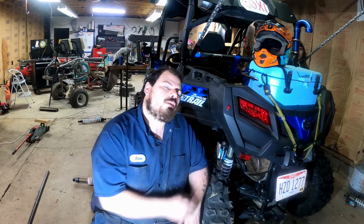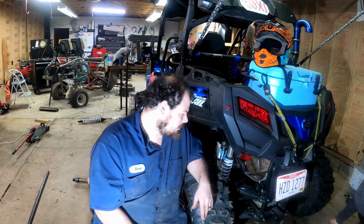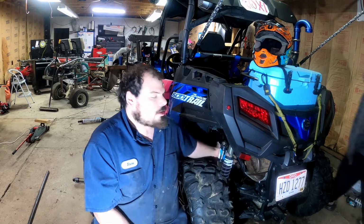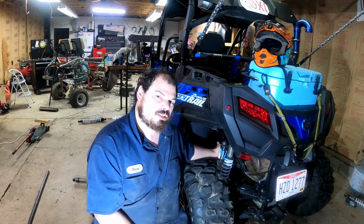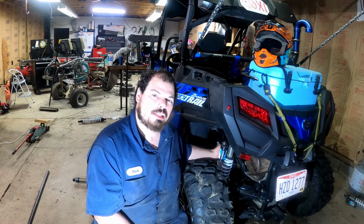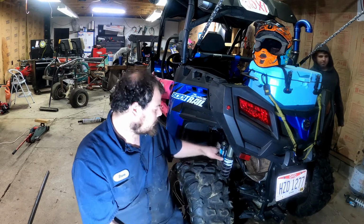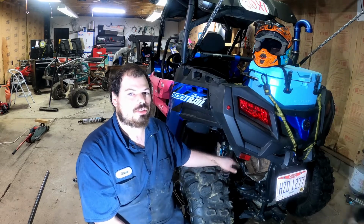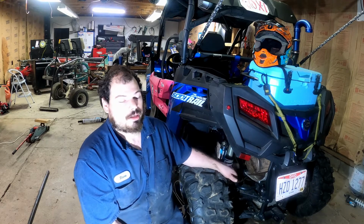Stay tuned. So here's what we got. The rear shocks bolt up just fine. You just have to grind that a little bit, or you can bend your tabs a little bit on your machine. It's not that much, honestly. Take all your preload off and put 3.5 inches down is where I got these set. And the ride height is still stock right there. There's plenty of adjustment, so you could get a good 4 extra inches without a lift kit back here.